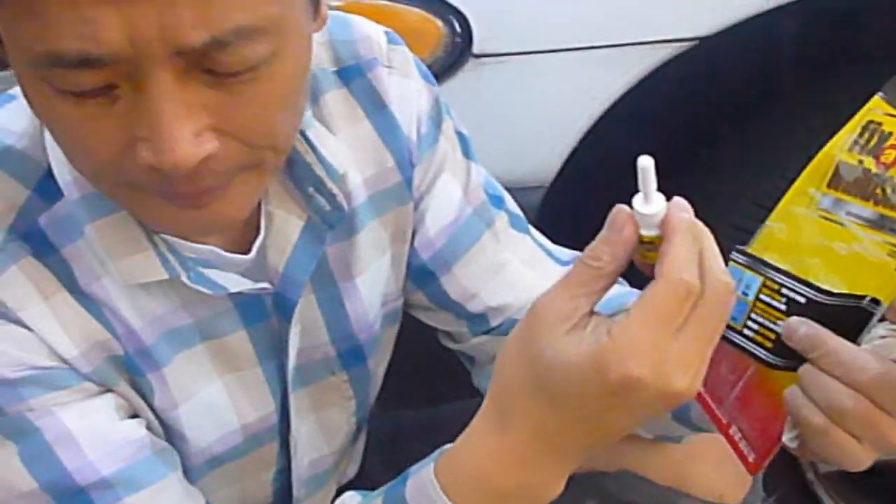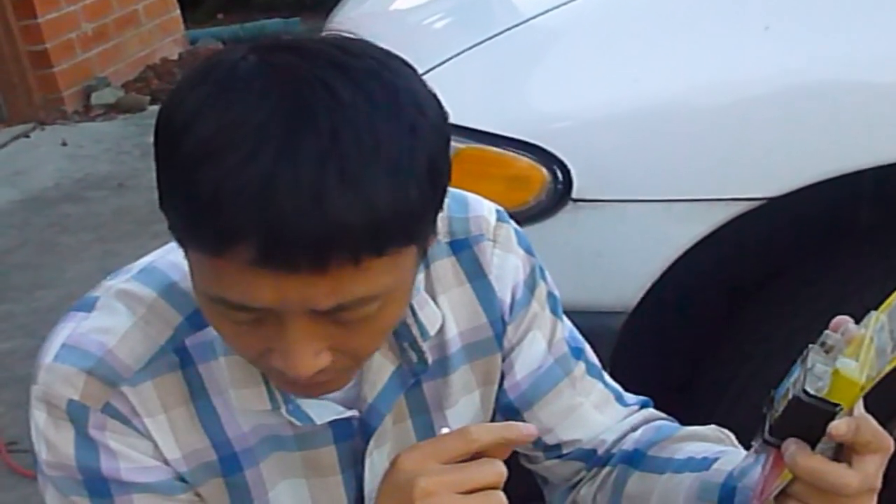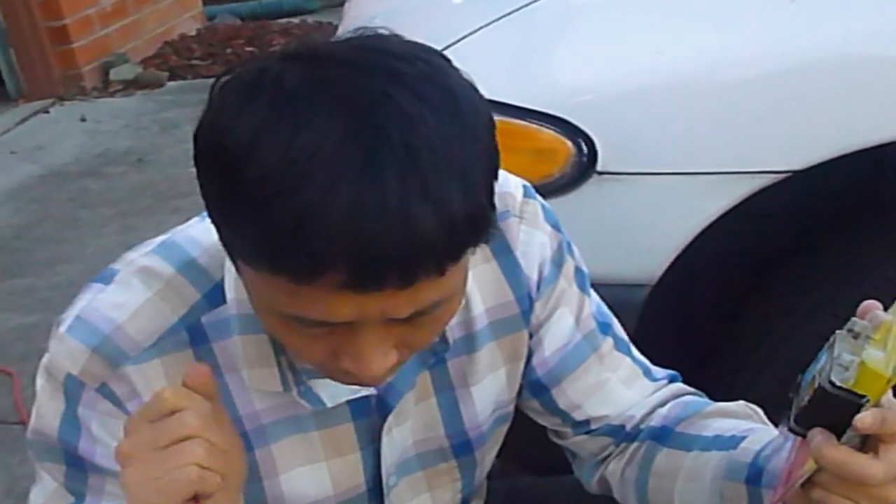This is very useful for us today because the crack is going to be repaired just by the liquid, without the suction cup. Because there's a very long crack that tends to extend, the end of the crack — if you solve the equation — is a singularity, which means infinite stress at the very end. So we're going to drill a hole at that very end of the crack.